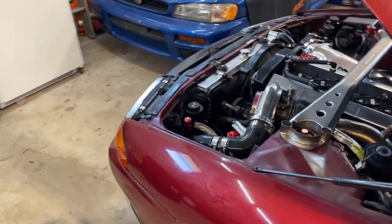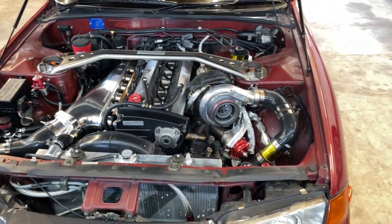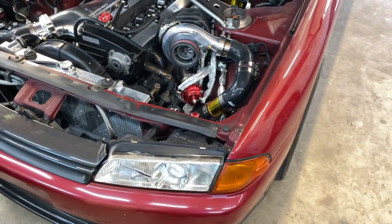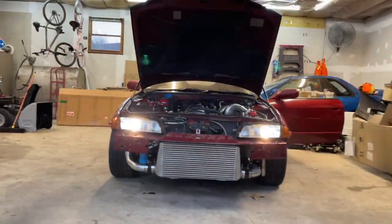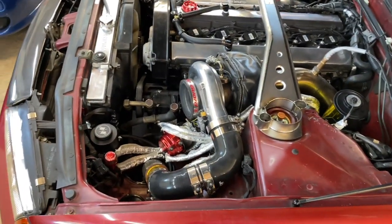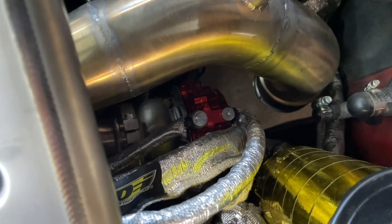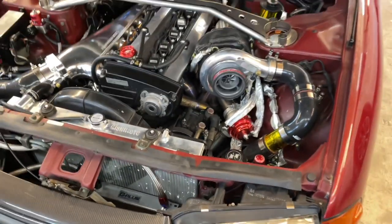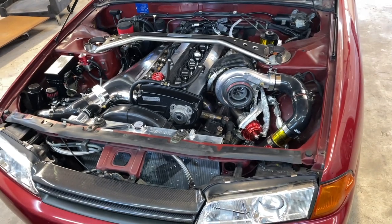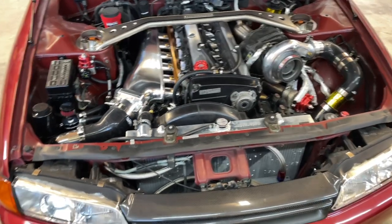There's no reason to make a statement like 'fix your exhaust leak to fix your spool up' — that's obvious. It's just whether or not you know the leaks even exist. I always knew I had a rattle coming from my dump tube but didn't think anything of it until I watched the videos and realized it sounded like an exhaust leak. I started the car up, put my hand underneath the dump tube, felt air coming out, took it apart, and found all my flanges were leaking. Now they're low-mounted and leak-free. We're going to get our tuner's advice on whether to retune — if he likes it, we're good; if not, we'll tune and drive like we've been doing. This car is definitely at least happier.